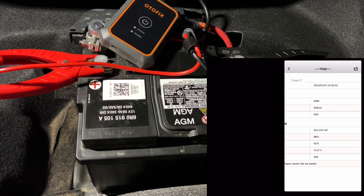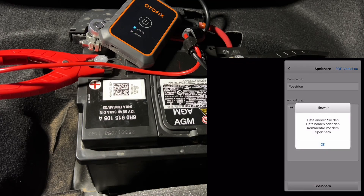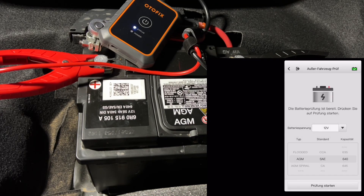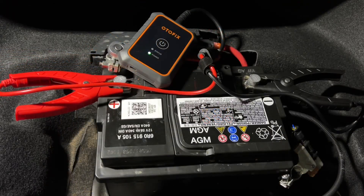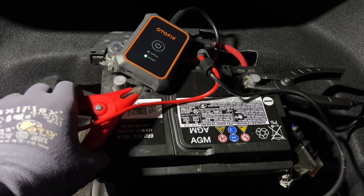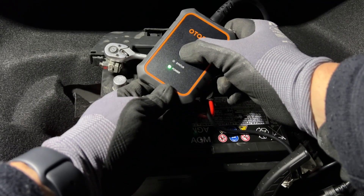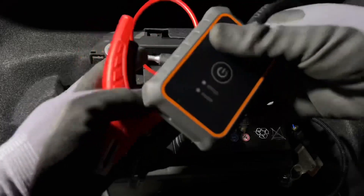On the device there are two LEDs. The status LED: solid green means the tester is connected via USB cable; flashing green means the tester is communicating via USB cable. Solid blue means the tester is connected via Bluetooth; flashing blue means it is communicating via Bluetooth. Flashing red means the battery clamps are connected to the wrong battery terminals — the device can detect this and alert you, so you will never clamp the wrong terminals again.